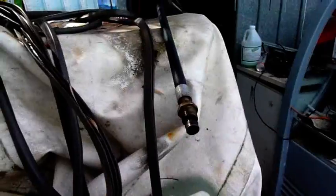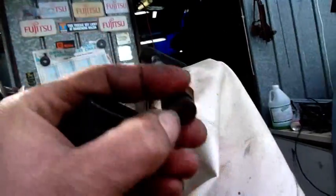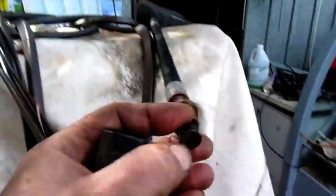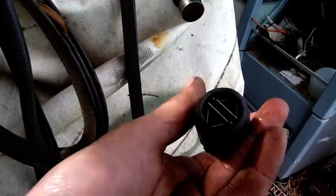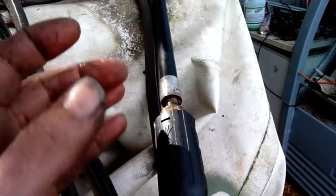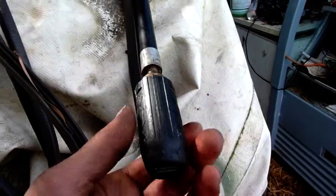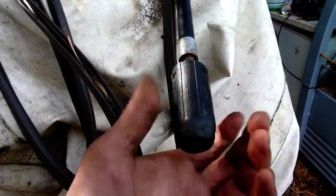I'm not a complete idiot after all. It's not so much how you screw the end on — it's the fact that that little orifice in there, the main jet, was blocked. Like, 100% blocked. It took a fair bit of force with a bit of spring wire to get the piece of crap out of it, but it's free now. I should be able to screw this back on and make some pressure. And that explains why it snapped back onto my finger when I pulled down on it while it was running — it acted like a piston and pushed back because of all the back pressure.